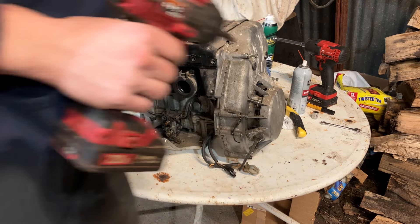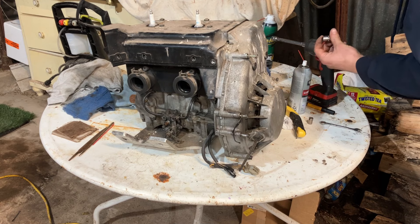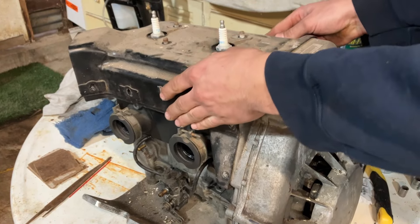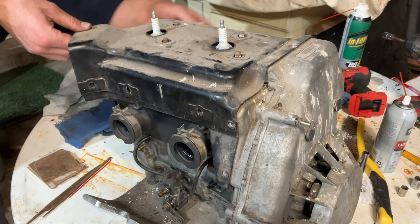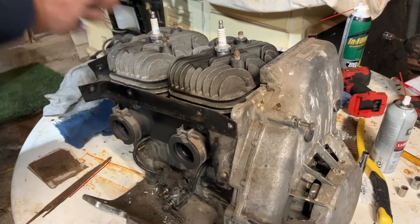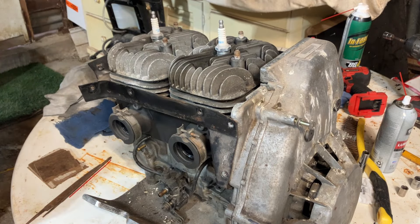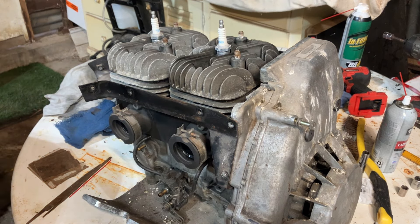I'll get a 12 for the four on top. Those are actually bolted with some of the nuts for the cylinder heads, so we'll do 12. Got those four off the top. Just getting this shroud loosened up. Taking note that this top shroud actually goes over the top of everything. If these sit a long time, you always want to take these off and inspect — make sure no mice got in here or built a nest underneath the fan shroud. That's how they overheat and put holes in pistons. Fan shroud's off.